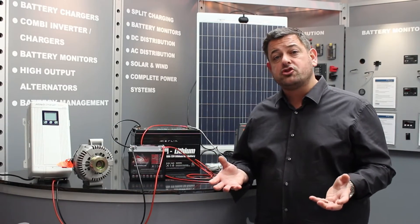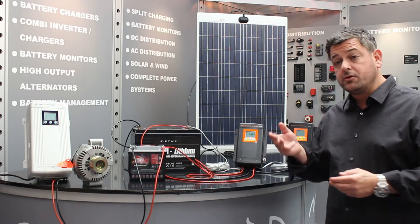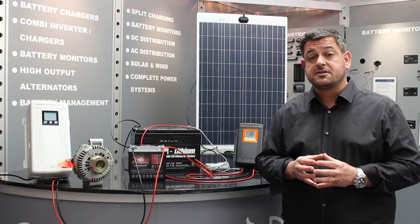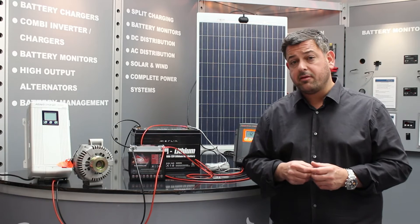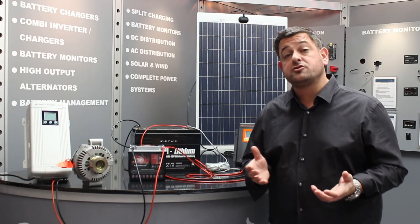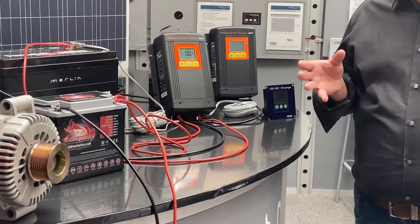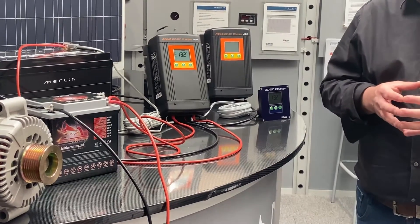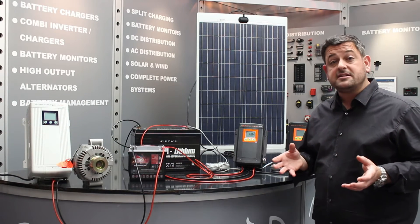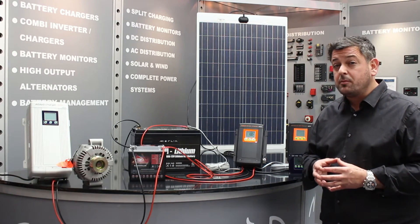Where we use a DC-DC battery charger, we recommend our ABSO DC-DC range. These units are available in three different types. We do a 12-to-12 volt DC-DC charger rated at 30 amps continuously or 50 amps continuously. We also do a third unit which will take anything between 12 and 24 volts input and give 24 volts output, which means that you can use it to charge a 24-volt auxiliary battery bank from a 12-volt engine system. A key feature of our DC-DC chargers is that the rating is a continuous rating — they don't derate when they get hot. We have tested 15 of the leading DC-DC chargers on the market with quite shocking results, where we saw a 60-amp rated unit actually derating itself down to about 18 amps.